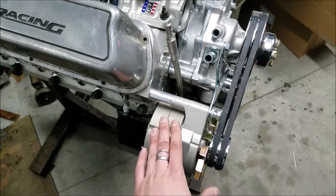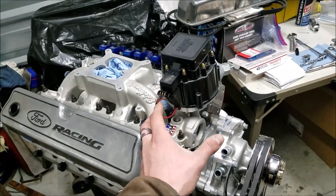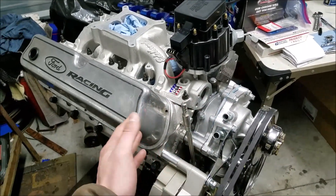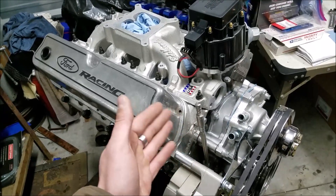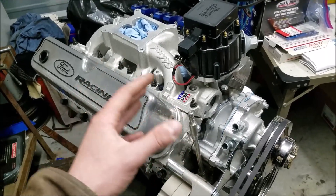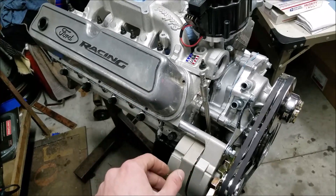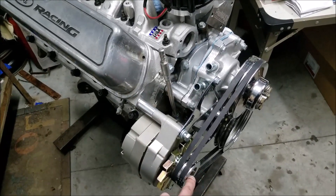These one-wire alternators work out really well. The idea behind using the HEI distributor is that we can take this entire engine setup and drop it into any vehicle — it accommodates electric fuel pump, mechanical fuel pump, whatever we want to do. The purpose of this Mabco engine short block build — if you follow my channel you might be familiar with it — was to be able to order everything in on Monday, and by the weekend have all your parts in, assemble your engine in one or two days, and have a completed engine by end of Sunday. I think we have all the parts and the parts list to make that attainable.